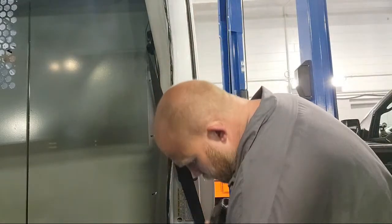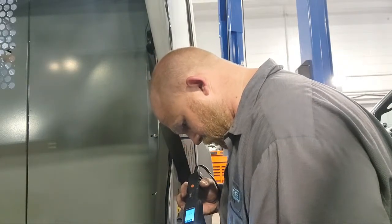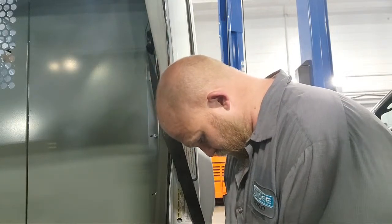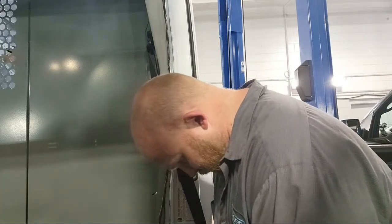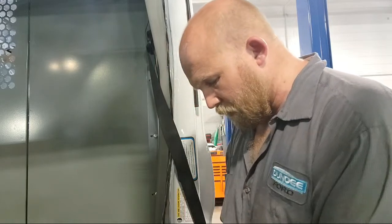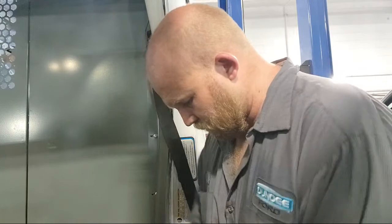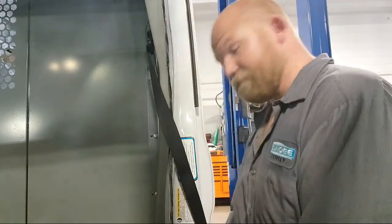So the big red one goes forward. I'm gonna cut this harness up. Well, I guess I could just unravel the tape from here. It looked like they changed the color of wire once it got down so far. They spliced one of the red wires into a black wire. It is open. It doesn't have no power. And that's open.